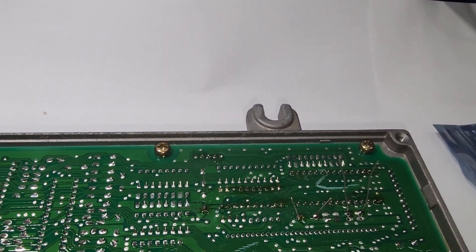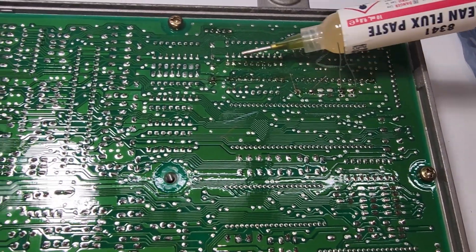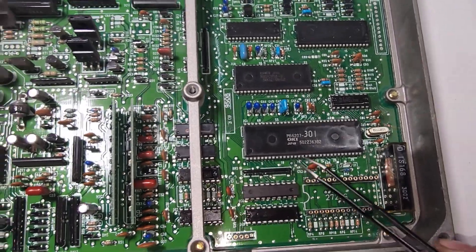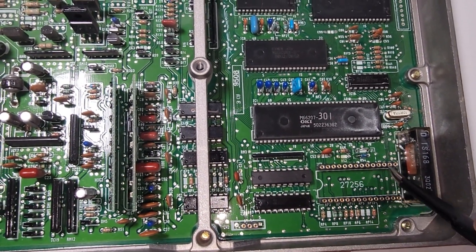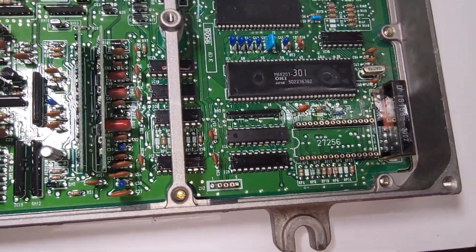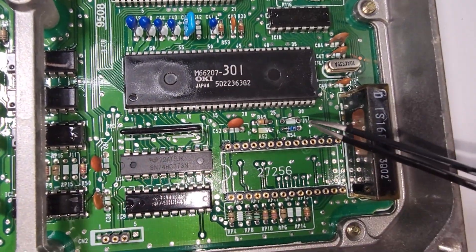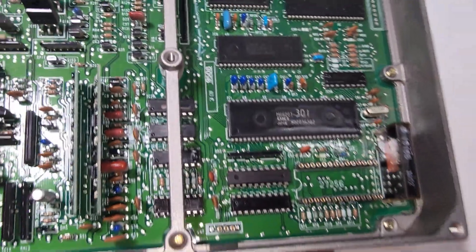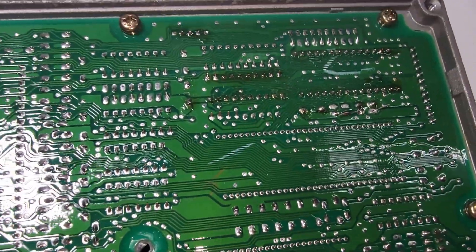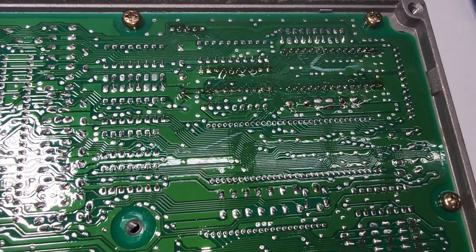You might need additional flux like this, which you add on before soldering — it melts and helps everything flow. From the top side you can now see C51, C52, R54, the three data logging pins, and the two chip socket rows where the Snake will plug in. I took one of the leg pieces from R54 and stuck it into J1 — right now it's just loose, put it through and bent the other side so we can turn it over, solder it in, and cut the excess off.